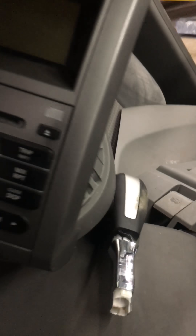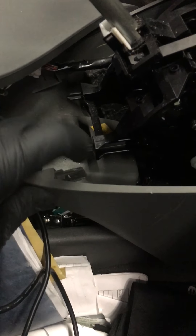This end of it is behind part of the radio trim, so you actually have to take that top cover off first — a couple of screws. On the bottom you have a bracket that's part of the cover, a couple more screws. For the piece underneath, they technically want you to remove the center console, but you don't have to because it moves and bends enough that you can manipulate it out. You can slide it out of these fasteners even though there's no clearance down here.